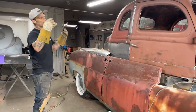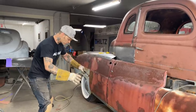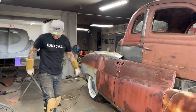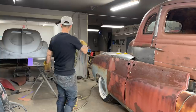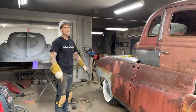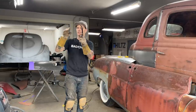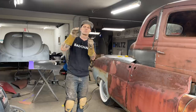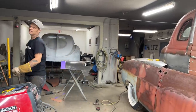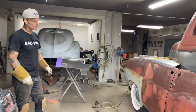It's just like when I sandblasted a chassis once. When you sandblast a chassis, there's a bunch of seams where it goes together, a bunch of holes, a bunch of everything. You take that in the paint room and do the best job you can, fill it all out, make it look nice, and rust will still climb out of that frame, because you will not have gotten all the places where the sand has gotten, and it will still come out and rust on you. I guarantee it. So it's kind of half one or the other.